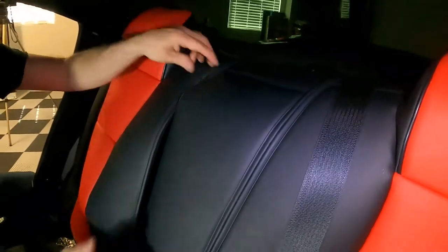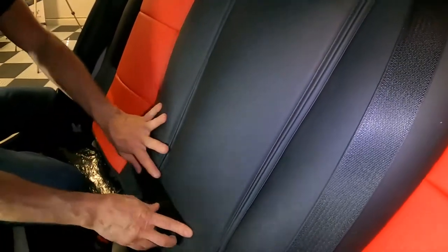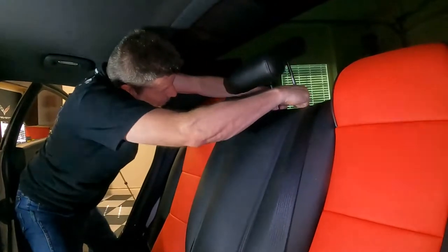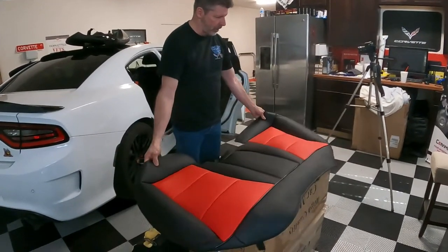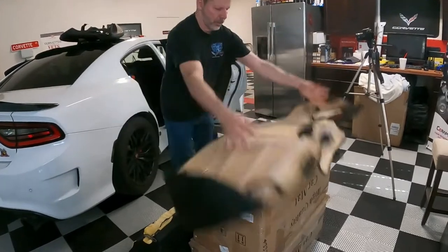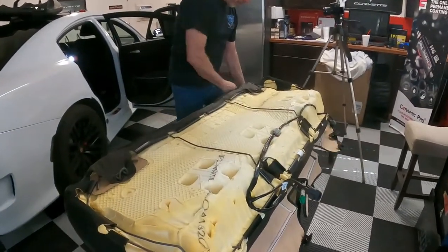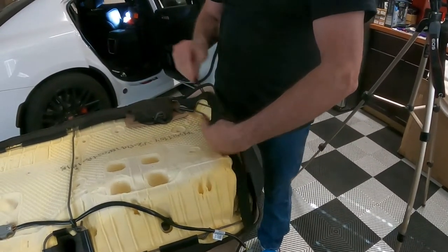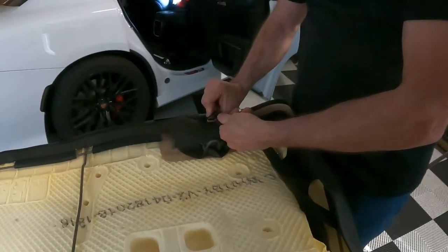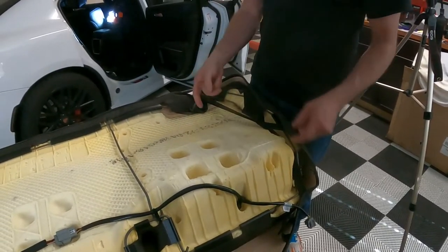You can go ahead and put the seat back up like that. Then you've got your zipper going all the way down, and then you can go ahead and put your headrest in. We've got our seat cover here for the back seat bottom. We're going to flip it over here, take the back seat, throw it right up here on top, and start strapping it down. Pull the sides up right here — you've got a strap that comes up from the front, loop it through here, come up here to the top, snap it in place. By doing it through here, this keeps the clip out of the way when you put the seat back in.